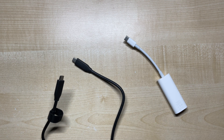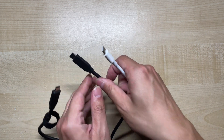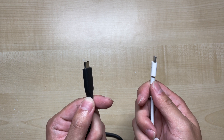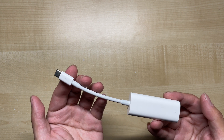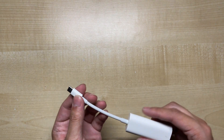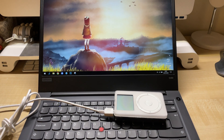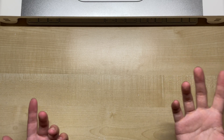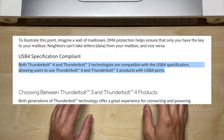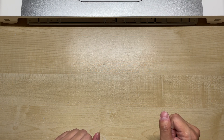One common misconception is people saying this will also work for any USB-C port. While Thunderbolt 3 and 4 use the exact same connector type as USB-C, it's important to know that they use different protocols. Thunderbolt ports can accept USB-C devices, but most USB-C ports cannot support Thunderbolt peripherals. The latest USB 4 standard is supposed to work with Thunderbolt 3 devices, but it's still super new, and you shouldn't assume that any USB-C port will work with this.